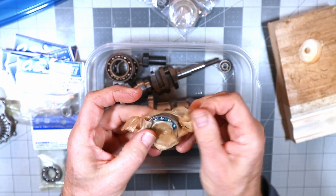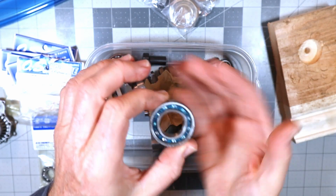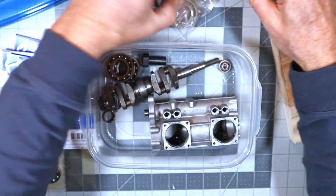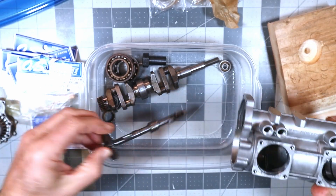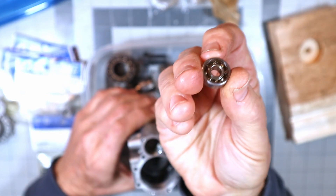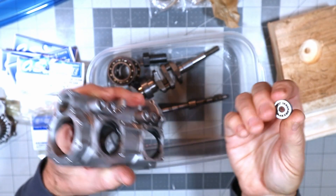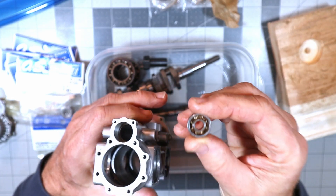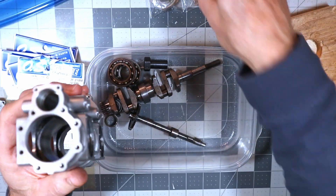The other bearings are the crankshaft bearings — I think those are what Horizon was calling 'mid bearings.' Here's a nice new crankshaft bearing; I slid it on just to check fitment. The only bearing I'm not replacing is the one in the front housing, because it's perfect — smooth as silk, feels brand new, makes no noise. Same thing came up on my 320 builds — all bearings needed replacing except that one.